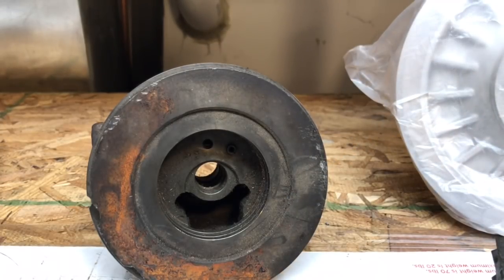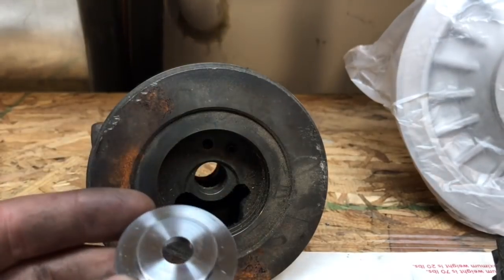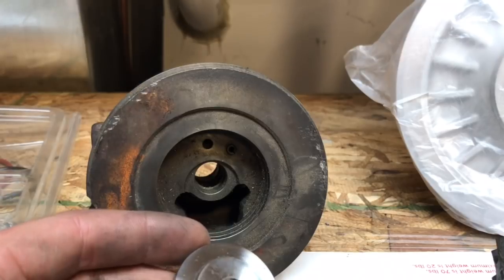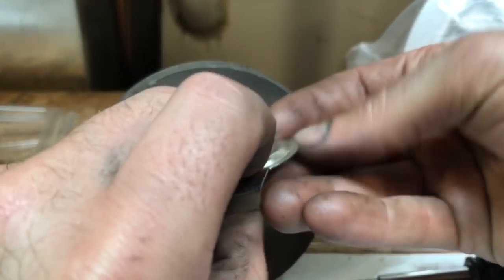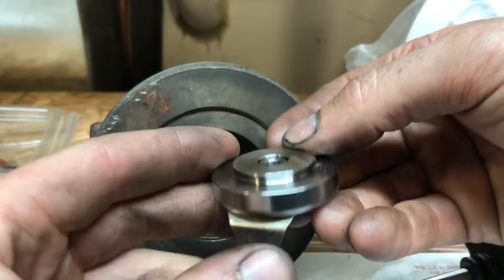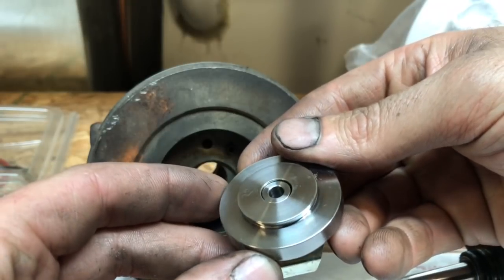The next thing that I ran into was the 14Bs have a flat back plate, and there's a thrust collar to match. The thrust collar is this piece. So this is what it looks like if you put a super back collar inside of a flat back plate. The collar doesn't come close enough to touch the compressor wheel, which means that the turbo is going to lock up.